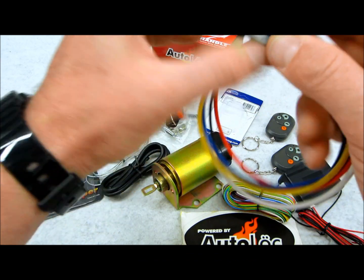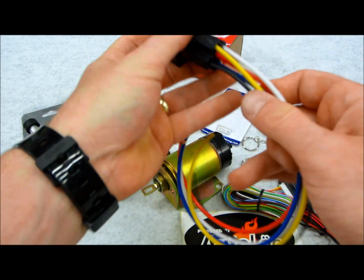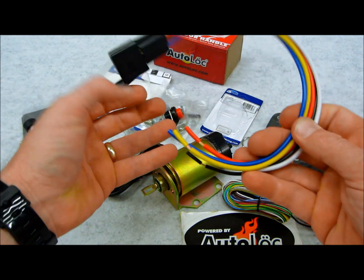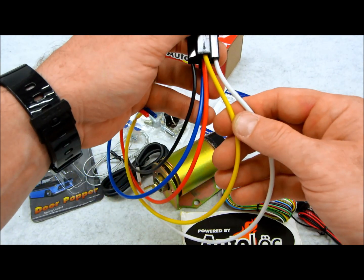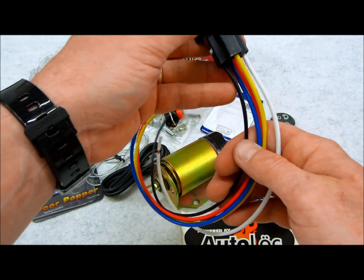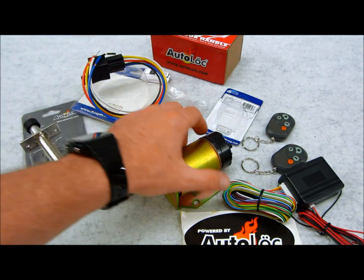And it does exactly what the company states, keep it clean. So that way you don't have to wire up female terminals and have all that stuff done because it's already pre-done. You have yourself a nice foot length of wire. You got about 14 gauge outputs. And these relays are going to throw the heavy gauge outputs, so the high amperage outputs I should say, onto your solenoid.